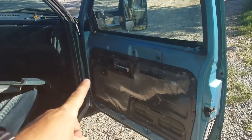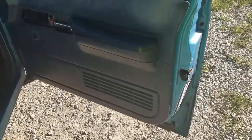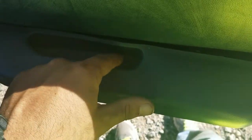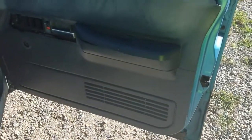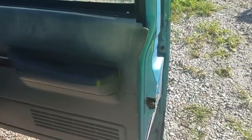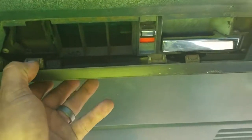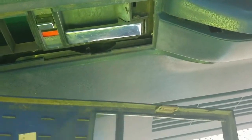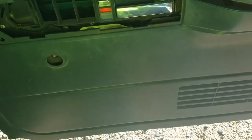The first thing you need to do is pull off your door panel. Taking the door panel off is pretty easy — there are just two screws down here and two screws in there, and then around the edges it has little pop rivets so you've got to pull it off. Once you've got those two screws out, you'll have this black piece that you've got to pry off — it's got little clips all the way around it and you've got to pop those off.